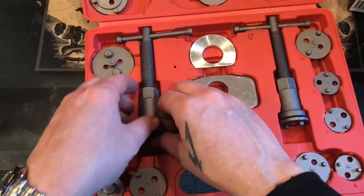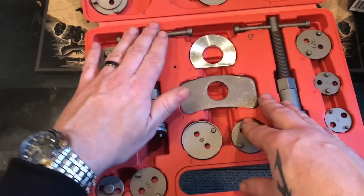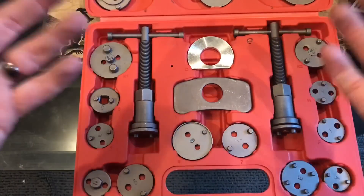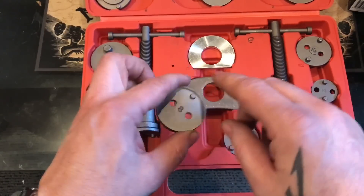For that slot I just kind of used a big flathead screwdriver and it seemed to work for the most part, but you do need pressure as this thing gets wound in. I was just being dumb not having one. Working at Toyota now, a lot of the calipers do have the two notches.